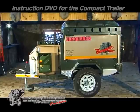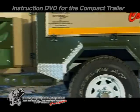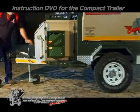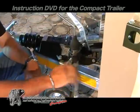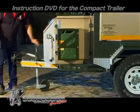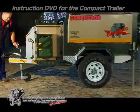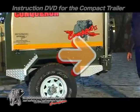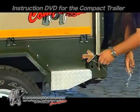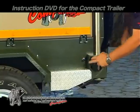Park the trailer on a level surface. The leveling will be done by lifting the nose. Ensure that the jockey wheel is tightened properly, the handbrake is pulled up, and lift the nose by turning the lever as shown. Release the tilt legs, which is positioned at the back of the trailer. These legs are not for leveling, but only to prevent the trailer from tilting.